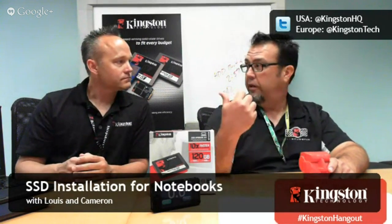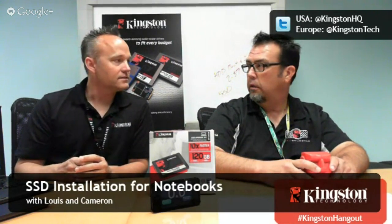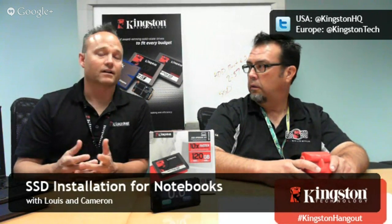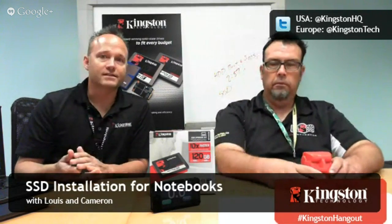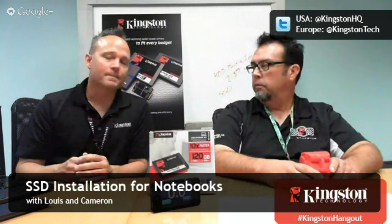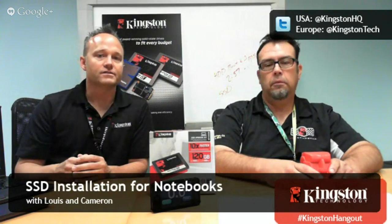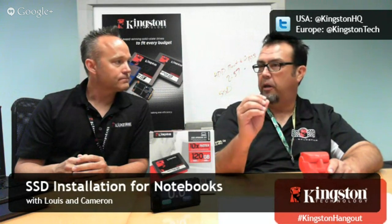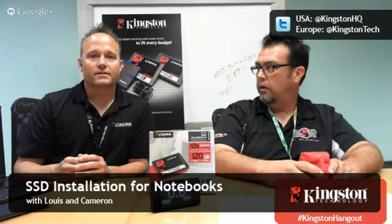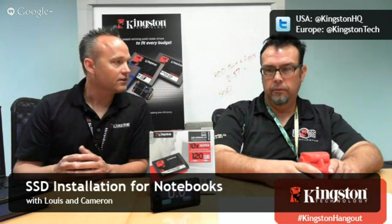You're working on a series of videos right now, right? That'll be on our website. Yep, for our HyperX team. We're talking a lot about RAID. We're talking about RAID 0s, RAID 5s, RAID 10s, RAID 1 mirroring, and how SSDs perform in those different RAID configurations. We see companies like LSI now that are actually putting special SSD features into their cards. Yep, their firmware is designed for SSD, so it'll detect an SSD and change the characteristics accordingly.